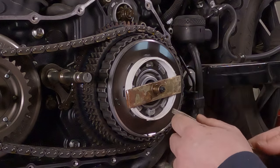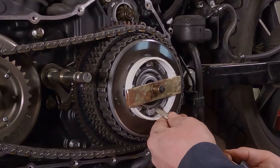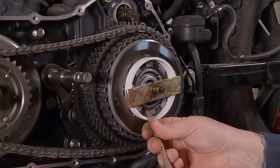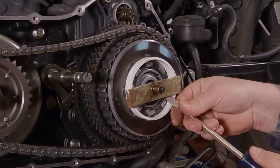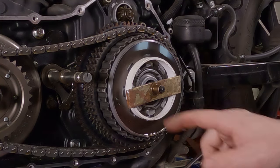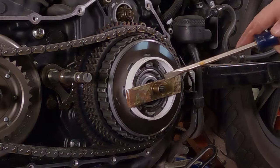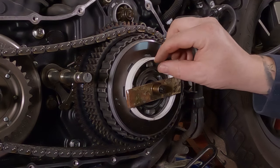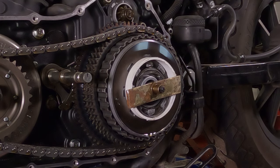So then there's a little ring inside there. Push that back so you have a little bit of clearance with the snap ring. And flick the snap ring up. There we go. Then you can just walk this snap ring out. There are some special Eaton-style snap ring pliers for this, but honestly, you can just walk this out with a flathead screwdriver. Have a little patience with it. Remember, this is a no special tools thing. So, there's another little ring right here behind this. So we're going to stop right here. And I'm going to take a picture with my phone.